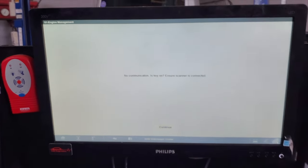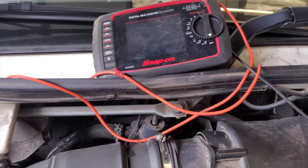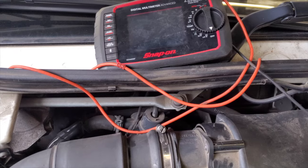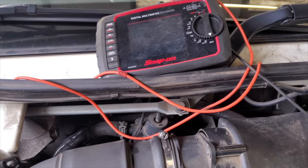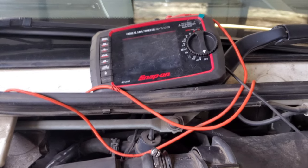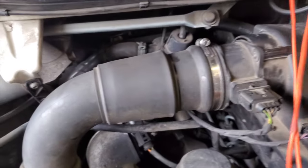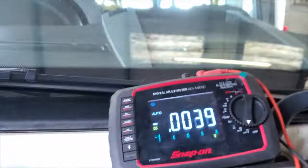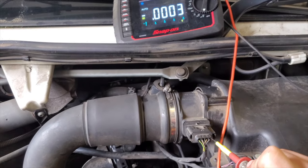It powers up the module but won't actually connect to the car at all. What I'm going to do is skip footage at the battery — nothing really to look at there. With a no-crank I think I'll test the 5-volt reference quickly. If that's bad we'll go to fuses, and if it's good we'll probably still go to fuses, but let's grab the meter and get in there.